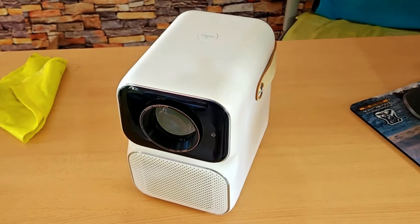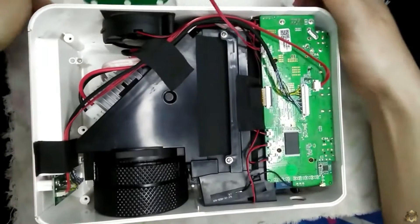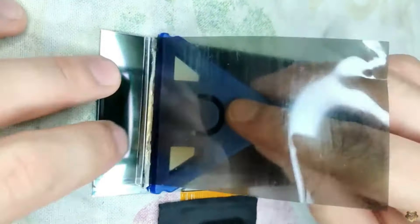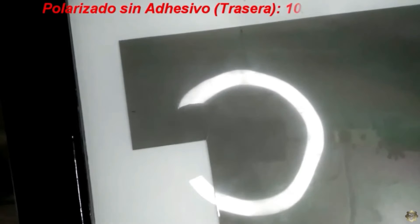Whambo has shown good construction and the advantage of having a second integrated fan and incorporating an independent polarizer crystal not attached to the LCD screen, which makes the 6 Max very repairable for issues like this by just replacing that crystal. However, in a cheap projector you won't have an independent polarizer crystal that's easy to change since it's attached to the LCD screen, and replacing it is a complex, delicate process with the risk of damaging the LCD screen — not to mention how hard it is to find a polarizer film with decal-type adhesive.